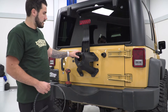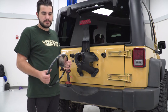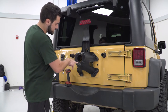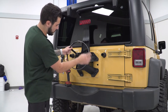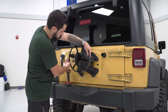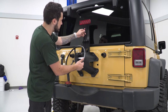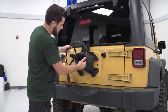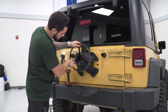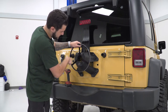If you're working with a factory spare tire carrier, this install is going to be the same for you. If you've got an aftermarket one, you may need to make some modifications or it may look a little different. For ours, we're going to install it right here in the middle. As you can see, the lug studs are a little bit in the way, so you can't center the connector — it has to be a little off-center. Whether you put this to the right or to the left is completely up to you. I'm going to keep it a little more toward the top so our wiring is easier to reach the factory wiring for the third brake light. I'm going to use the inner top hole and the outer holes for the two lower spokes.